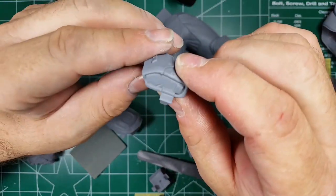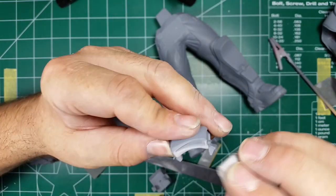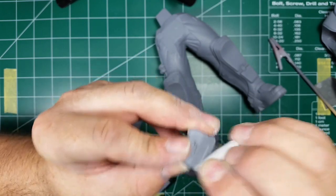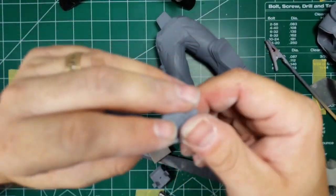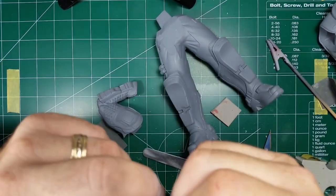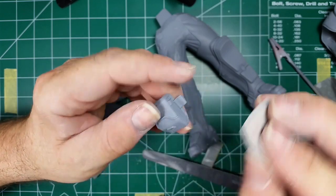The pouches look really good out of the gate so I shouldn't need to do much to them. But I see a little something here — it looks like a fish eye, which is probably some contaminant underneath the primer. I'll sand those out and spot prime. A fish eye is when there's dirt or oil on the surface — it's like when you put dish soap in a sink and the oil separates. The paint separates around that spot. I also noticed a bubble in here I need to fix.